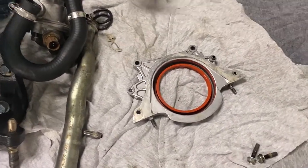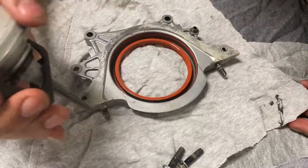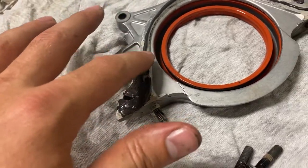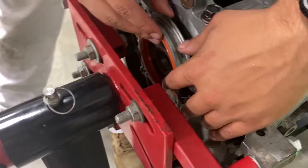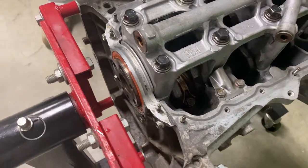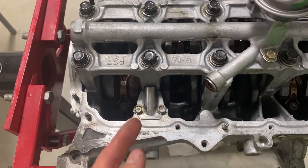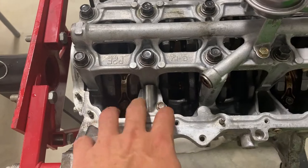We got our professional dime-stacker here, so he's going to run some RTV on this machine surface on the main seal. Clean the tip always — just run around the hole. Stack your dimes from A to B, don't get fancy. I almost hate to put it on the engine, look at this perfection. So we got the rear main seal on, we got the oil pump on, and the oil pump pickup on. One thing I noticed — I had it sitting in that pan over there to be put on, but that was from a different block; this block we never took this off. It's an oil return guide — it's there to help keep oil from being flung up and resisting what's coming back to the pan, so it's important you put that back.